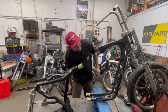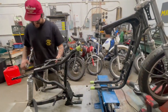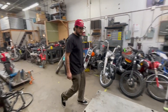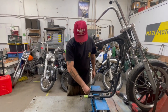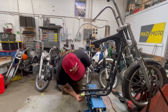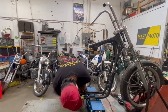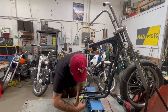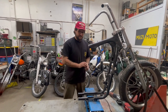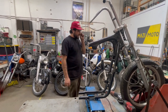There it is — the cuts are done. It's hot — I put my hand right on it. We got a hardtail! We got a Sportster hardtail — half hardtail. This is what we live for. It's pretty crazy how little frame is left when you cut everything off to hardtail it — like you do a shovelhead hardtail, there's like half the frame cradle and then the neck. I'm just going to clean these cuts up, make them straight, and then we can fit up the hardtail.